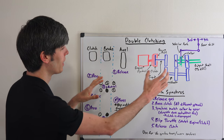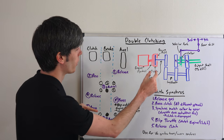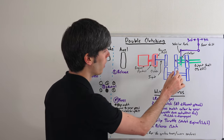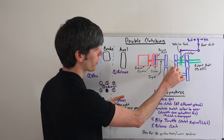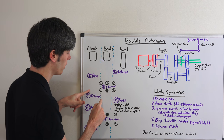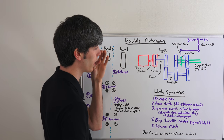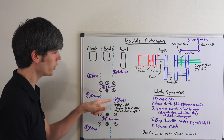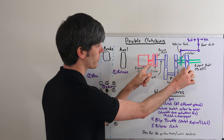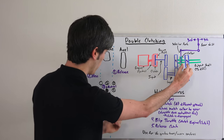Let's walk through this process looking at what's going on inside. First we release the accelerator, then we press in the clutch — now the red and blue groups are no longer rotating at the same speed. The collar is also rotating at a different speed from the gear at that point. Then we release the clutch, which links up the engine to everything in blue — so blue and red are now rotating together. This gives us influence over the third gear speed because it's now connected to the engine.